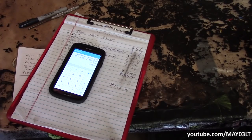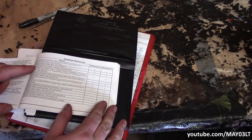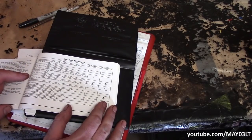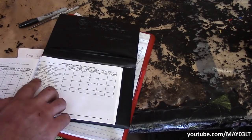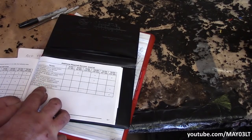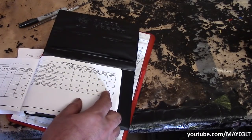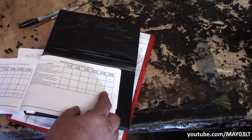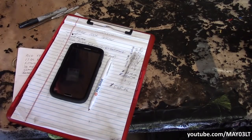Looking ahead at what else we've got going on: lubricate chassis — that's something we still have to do, but that's not part of the 100,000 mile service. The only other things would be checking the belts and the engine cooling system service — that's five years or 150,000 miles. We don't know if this coolant's ever been changed, so we've got a mental note of that. The fuel pumps on these tend to last about 120,000 miles and we're right in that ballpark range, so we are going to put a fuel pump in this thing for preventative maintenance.